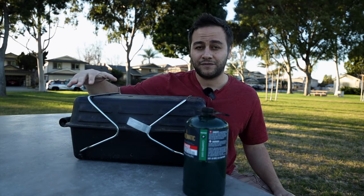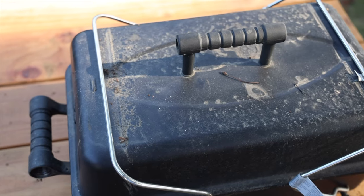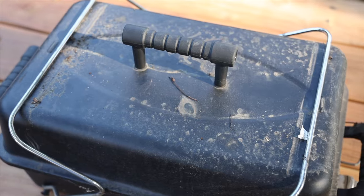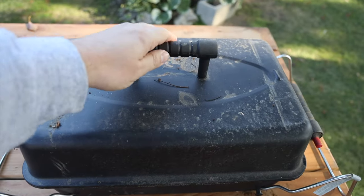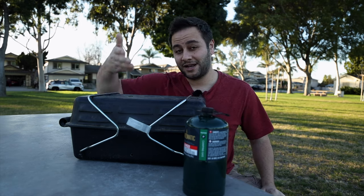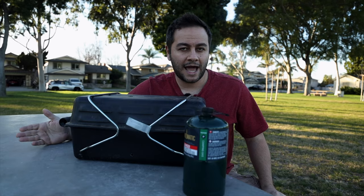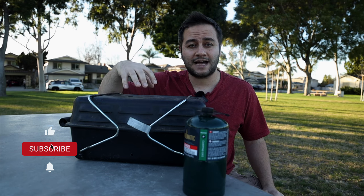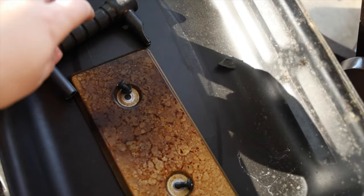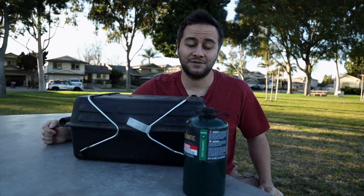As you can see, something is definitely missing from this grill — the top handle. While filming b-roll for this video, the top handle completely snapped off, which I kind of expected because over the year it had been getting brittle. The side handles are getting pretty brittle too, so I expect them to snap off relatively soon. I wasn't doing anything extraordinary — I literally was just lifting the lid off. It probably had something to do with the handle being extremely cheap, threaded plastic. It's sitting on top of a heat source, which heats up the plastic, making it brittle until it eventually snaps off.